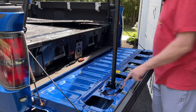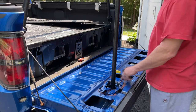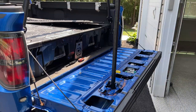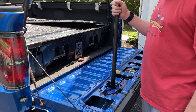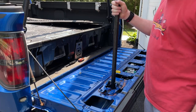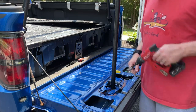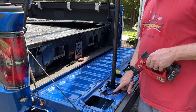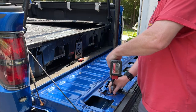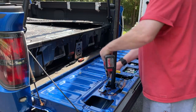Now there are six T30 screws around the bar. I've already taken this off and I'm just going back over the steps. I've already broken these loose and you can also see there's some primer. I needed to use a socket and a ratchet, and put a lot of effort into it because these are snugged down pretty tight from the factory.